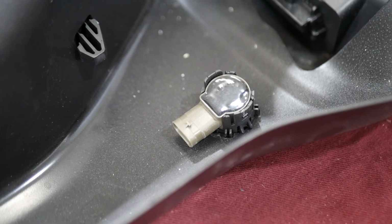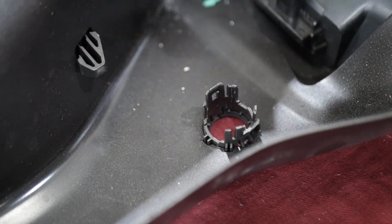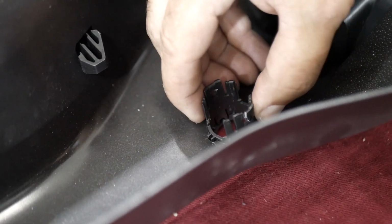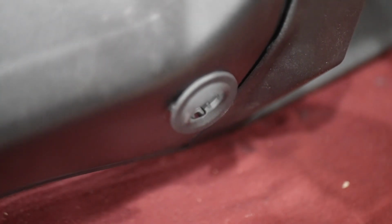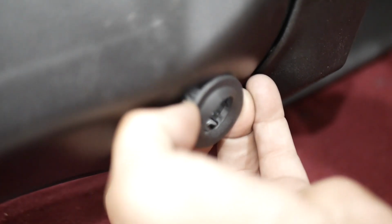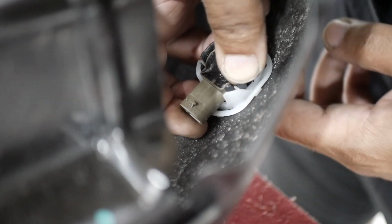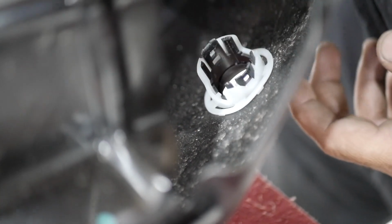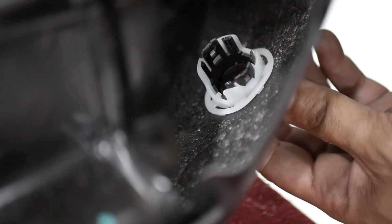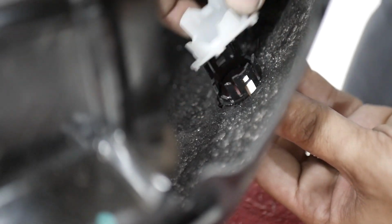If equipped, locate and disconnect the license plate light and parking aid sensors. Vehicles with rear parking aids need to remove the 2 inner parking aid sensors and isolator rings by carefully spreading the lock tabs from the isolators and separating them. The sensors and isolators will transfer into the RTR bumper. Then, remove 2 outer parking aid sensors and isolator rings by carefully spreading the lock tabs and separating them. The outer sensors are housed inside of 2 rings, a male and a female, and should be kept separately to avoid any confusion during reassembly.